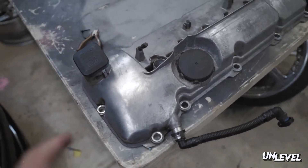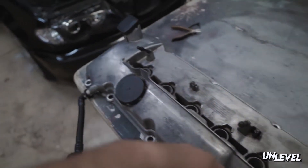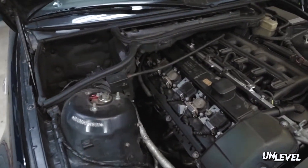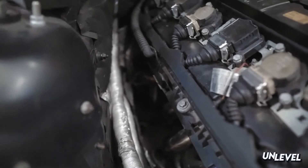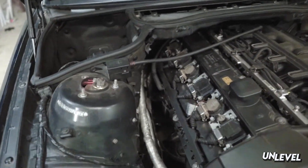I'm here for this — I do plan to swap over to the M56 valve cover. One of the pre-recs I was just doing: last weekend in the video I posted, you could see the O2 sensor wire ran up here, zip tied to a line and going over the valve cover. That wasn't gonna work, so I unbolted the OEM heat shield, re-routed it under and through the firewall, and it's out of the way now.